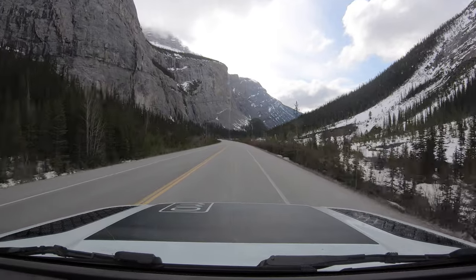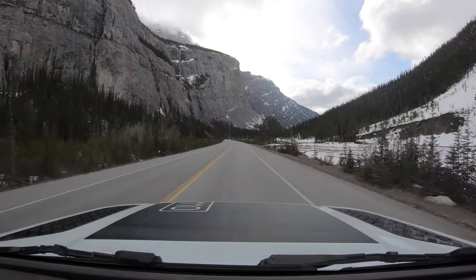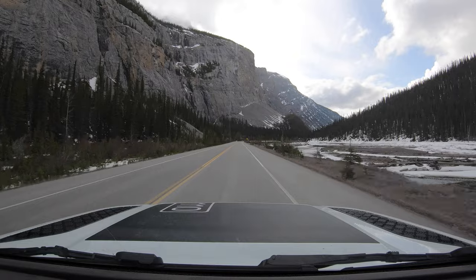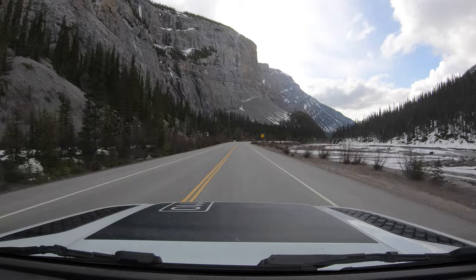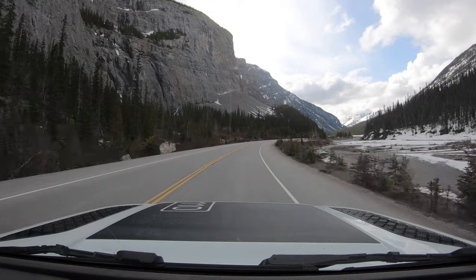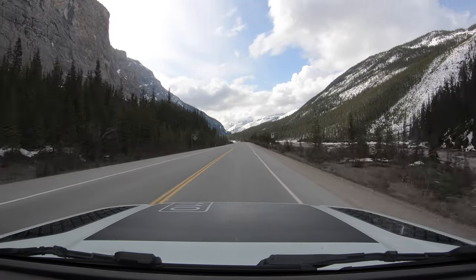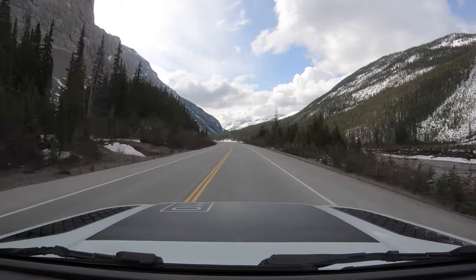It is opposite to the way in which truck drivers drive, and I've done 2 million miles as a truck driver. Coming down mountains like this with trailers attached, which I did with the trucks, and also when I've towed the caravan, is done by dumping a bunch of gears and dropping your speed at the top and letting it roll down. But as you saw earlier on, that's not really possible with the Defender, because it won't hold itself back, let alone a trailer on the back, and that forces you to be using the brakes all the time.